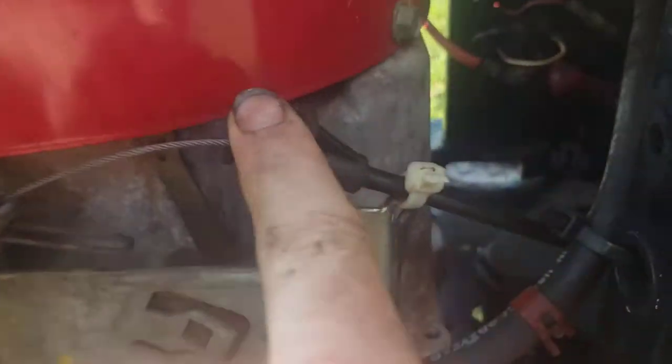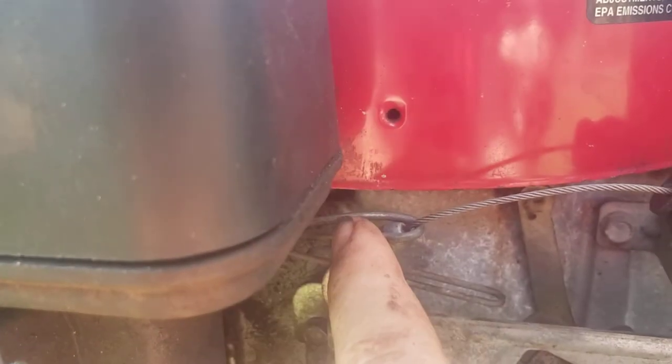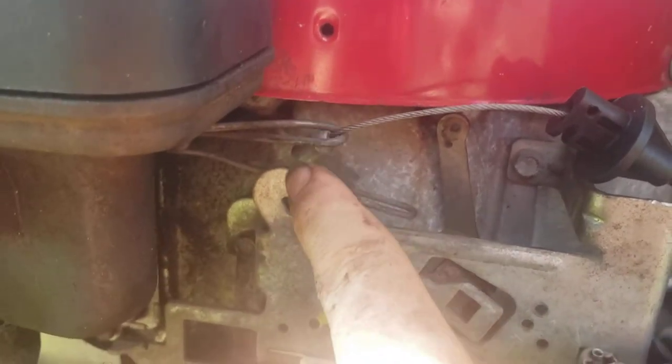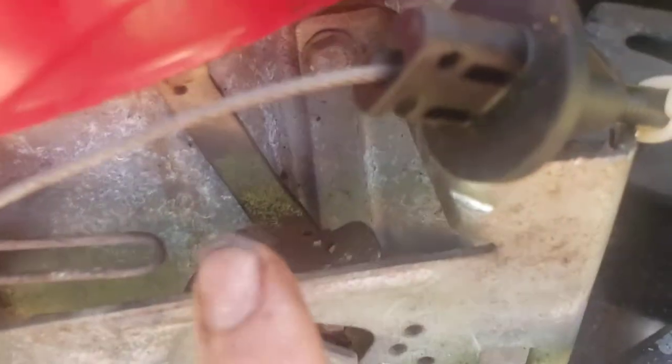You can see how I made that — I'll put a link in the description. But if you come over here, this is the excess throttle cable — the deck engagement cable — and you see it runs right into here. This is that big knob; this is the end where it hooks into the deck. The other side over there is where it hooks into the engagement. I took this, put it in there, bent it around — it's kind of floppy but it works. Then it goes back into here. See that spring? This spring used to go in there to hold the governor back.